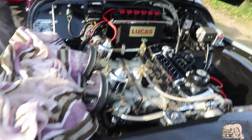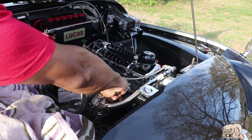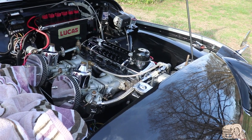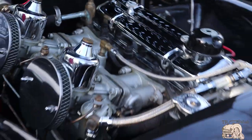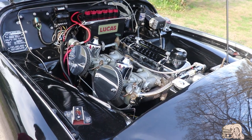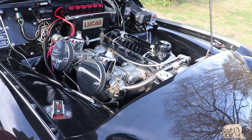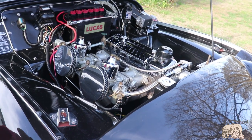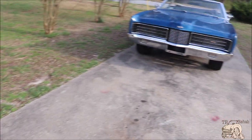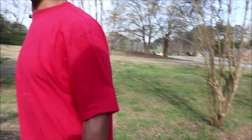I'm going to fire this back up and crank it from the solenoid. Like I said, that'll buy you at least a mile down the road. We've got a fuel pump issue, and that's the easiest way to troubleshoot this on the TR2s, TR3s, and even the TR4s. I'm not real familiar with the TR6s, but I would imagine this is a practical must-have on any of the Triumphs or British cars — or any cars for that matter, because on my son's XL we got the same thing. Until the next time — TR Rehab.